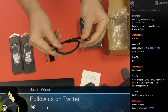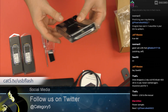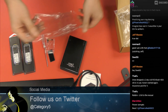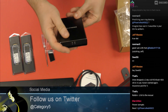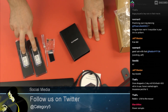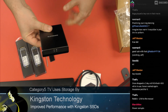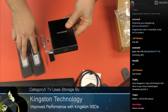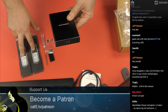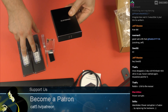This is USB-C — USB 3.1 Revision 2 — which means this external chassis provides a connection to your computer at up to 10 gigabits per second. The SATA 3 specification is 6 gigabits per second, so these M.2 chips are limited to 6 gigabits per second. In a RAID 1 scenario I'll get 6 gigabits per second. I could set these up in RAID 0 and potentially hit 10 gigabits per second, but in RAID 1 I'm capped at the SATA bus limit of 6.